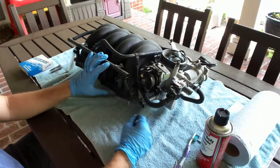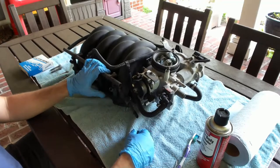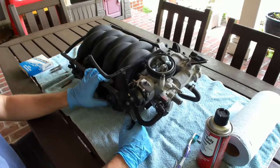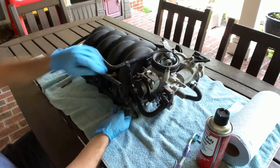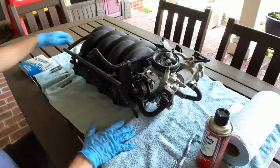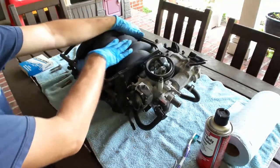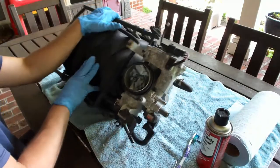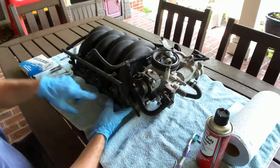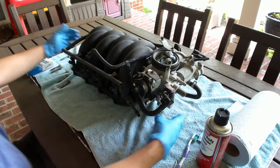And basically from there, it's another fuel line area right here, where one of the fuel lines connects. You'll have to have some fuel line disconnects there. So, pretty straightforward. Obviously, the bolts go in these little holes here, as you'll see. And for each and every one of them, you want to put them in at the correct torque spec and in the correct order in the manual. I'll be going over that when I put this thing in eventually.